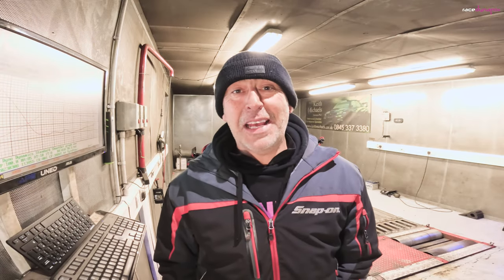So 400 horsepower, how do we get there? Previously, it's been the reserve of larger turbos like Garrett, or some horrific cheap eBay specials that are based on a TD06, where you can measure the spool up with a sundial. Very bad, and will actually make the car slower in the real world, even though it might produce the power.